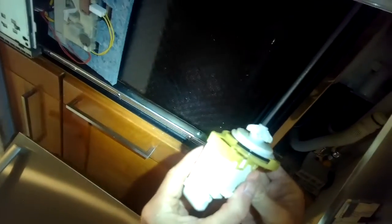Here's that panel that was kind of in the way. Here's how you put the new motor in: go in at 45 degrees, then turn vertically away from you. Make sure before you turn it that you really get it pushed in as far as it can go into the sump housing — wiggle it around, and then turn it and it'll click into position. Then put the inlet tube back in.